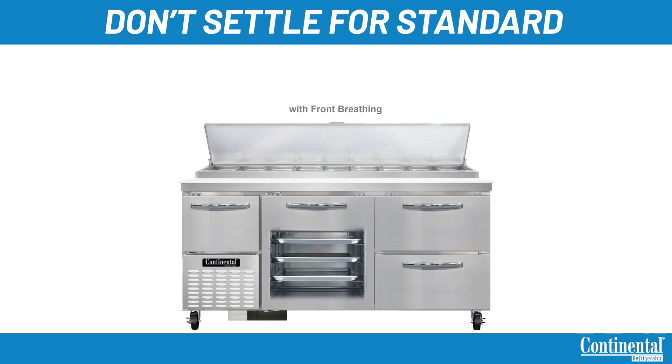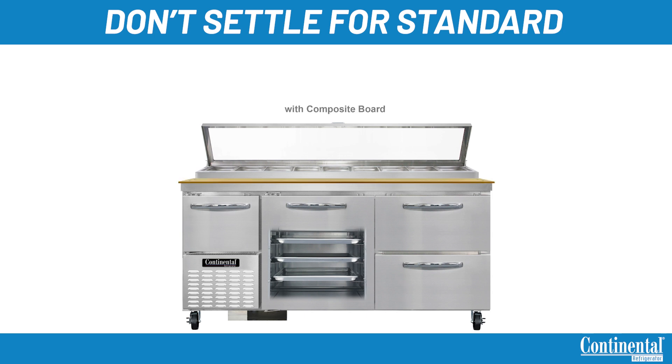The pizza prep line comes standard with a flat, insulated lid, but can be changed to a vision panel lid for product visibility. Pizza preps come standard with a 19-inch nylon cutting board, but we have the option for a composite cutting board for easier cleaning and less chance of staining. Wire rod garnish racks for excess topping fallout are also an option. Pizza prep units come standard with a 5-inch overall height caster, but there is the option to get a 4-inch or 6-inch black or stainless steel leg or various other options of casters.